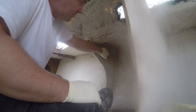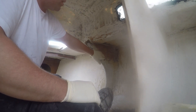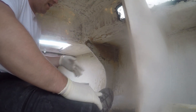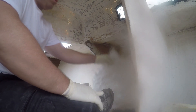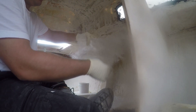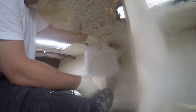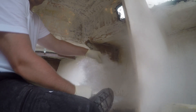I'm going to put some glass here, just to sort of fill it in because there's a very high spot here and I don't want to put a ton of filler in there just to fill that gap. So I'm going to use fiberglass — same as before, not fancy. Just rip it apart, get the wisps on the edges. I'm going to pull this off a little bit here. Then I'll just wet it out, put it on, wet it out again, put another layer on. It's like paper mache from days of old.